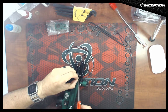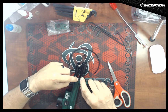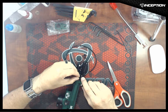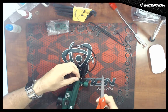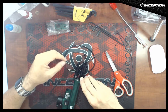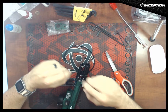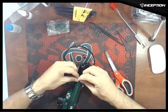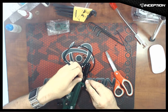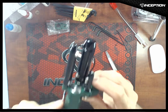It's always best to cut the hose a little bit long to start with, put it into place, and see how you like it before you push it on. We've got plenty of hose so we can make them a little bit longer and then trim them down. I'm going to take about one-eighth of an inch off where I first cut it. That looks pretty good, so I'm going to put two hose locks on — one goes right down against the RAM, the next one gives me about half an inch of clearance so I can grab the hose, push it onto that first barbed location, and bring the hose lock over, push it down over the fitting. You end up with a very nice routing for that first hose.